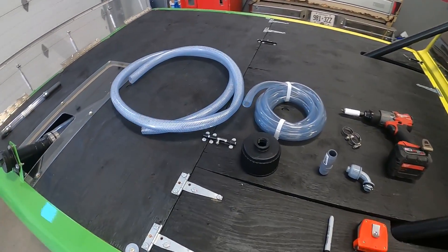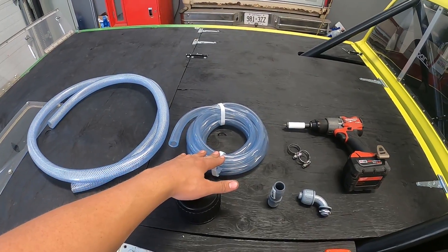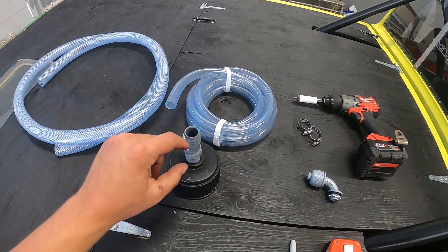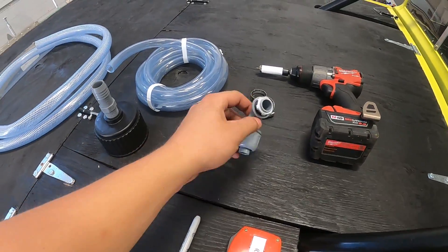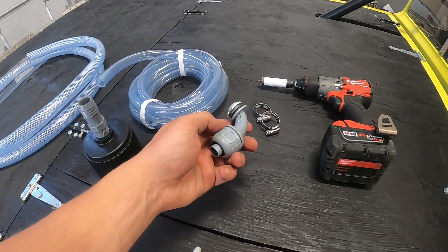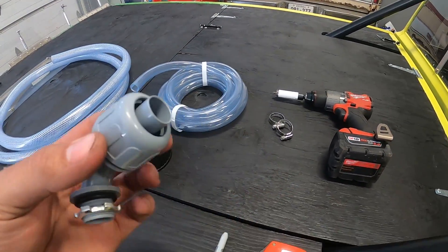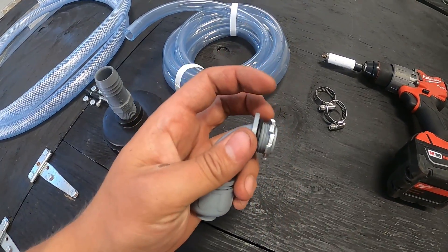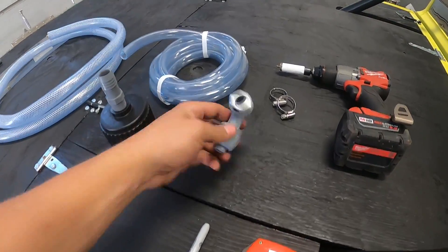Here's your material list. We've got some one-inch hose for the filler and some five-eighths hose for the vent. I've got a nice little adapter I found at the hardware store — it's three-quarter NPT to one inch — that'll slide right on the end, bingo bango, you're done. The vent was a little trickier, so I went to the electrical end of the hardware store and found these 90-degree liquid-tight fittings, which are for conduit and such. Five-eighths hose slides right on there perfectly, and it's got an O-ring and a lock ring on the backside to vent the can and seal it.